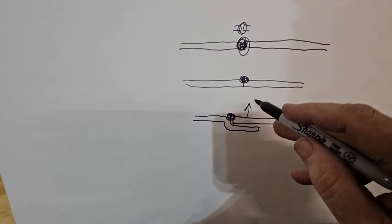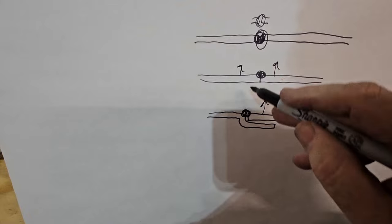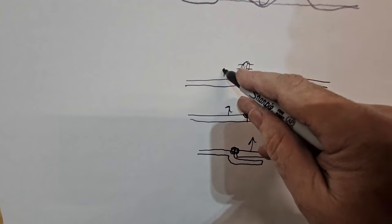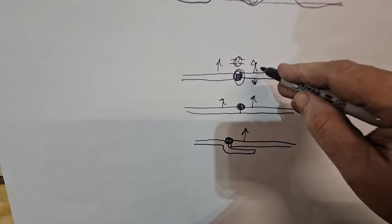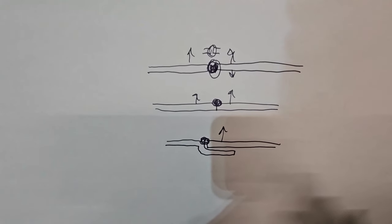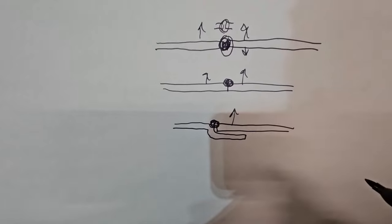If you took any kind of motion like this, then that weld is going to snap and it's not strong. You can twist and move and do all kinds of things with a butt weld that's got full penetration, and it's always going to be superior to either one of these two. And I want to make sure that I do it right the first time, so I don't have to do this again, so that whenever my grandson hopefully gets this truck, it's going to still be intact and he ain't going to have to do all this. He's just going to be able to enjoy the truck. Butt welds with a small gap are always superior to a surface weld.